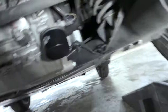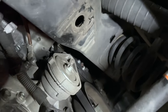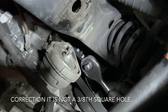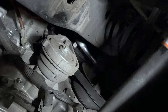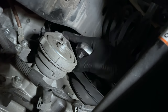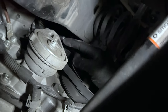So you can get some simple little ramps here. You'll notice — this is your belt tensioner. Over here is a 3/8 hole. Take a 3/8 socket, and you will squeeze it — either a socket or you can get a breaker bar. What you want to do is shove it into this hole and turn it clockwise, and you're gonna release this belt right here — this is the one for the alternator and water pump.